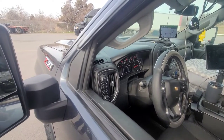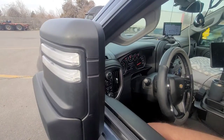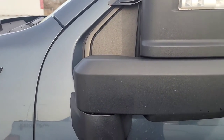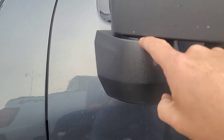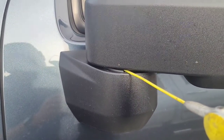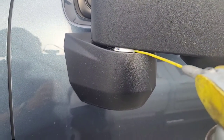Since I sprayed it, it's been about three weeks and he said it's had no troubles. When I bought mine it didn't have any trouble after I sprayed it either. So what I'm going to do is right in here — there's a little hole. If you pull back on the mirror with it folded in or out, bring it around and you'll notice there's a little crack where it raises up. I'm trying to do this without getting it all over his clean truck — just a couple of little squirts.